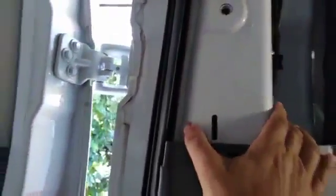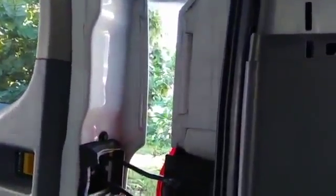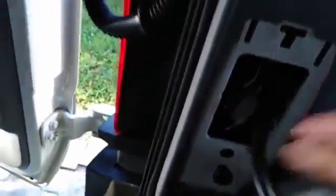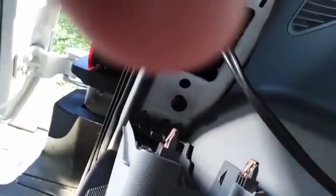I worked through here, down through here — this is nothing but metal structure, it's the structural framework of the van, and you could almost call it conduit. I split the wire and taped it — you have to split the wire to go through the two little holes. I loaded the wire in, put my fingers in, guided it, pulled it through, and ran it over. And there's the wire running across the van to the solar generator over there. That's really all there is to it.